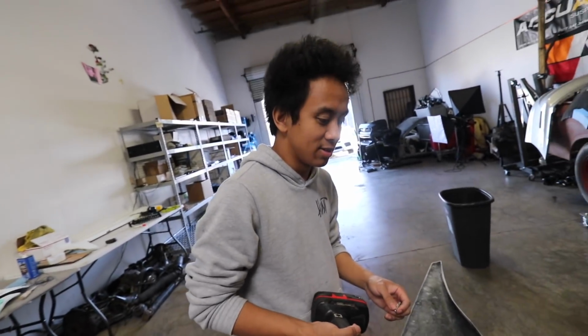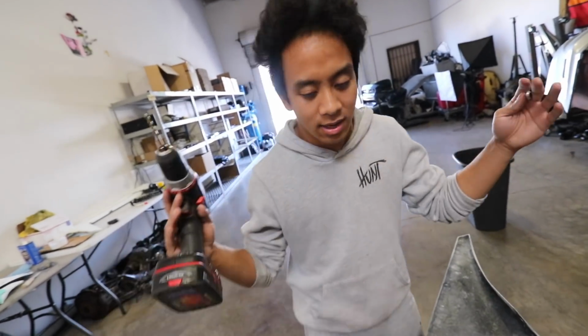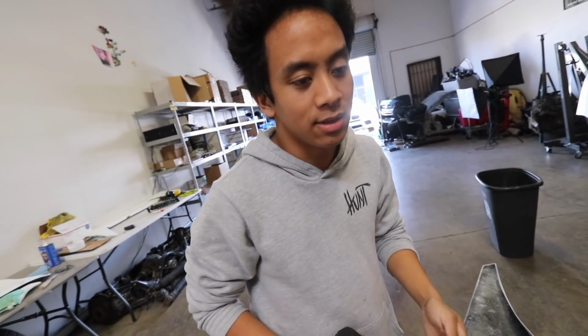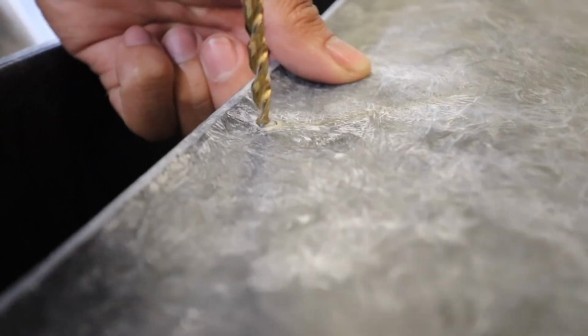It's pretty weak. Is it weak? Yeah, I tested it. Really? Weak? Yeah, I held the fender up to it, and most cars have a lower control arm to control the camber, and when the wheels go like this, my fitment disappears. It's gone. Bye. So when you slam it, your camber just... Well, I have those camber arms that we're gonna put on and see if that helps at all. If not, oh well.